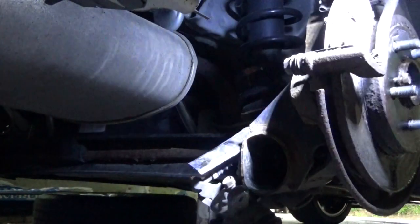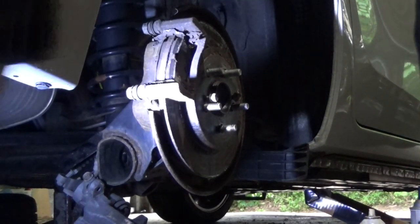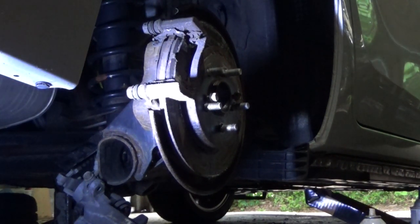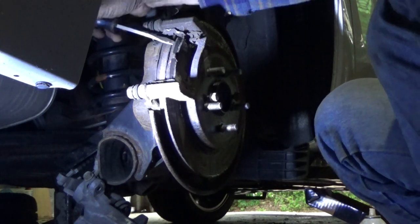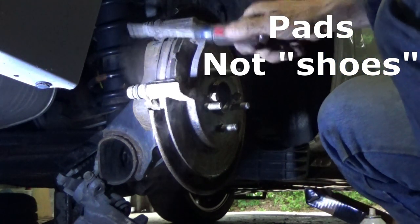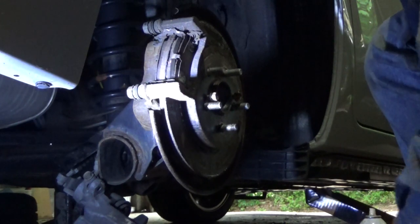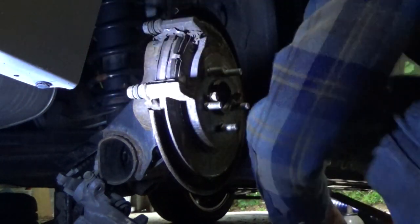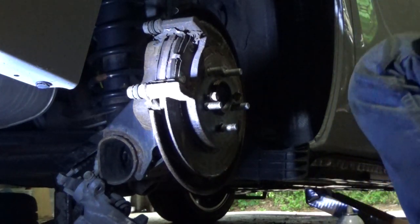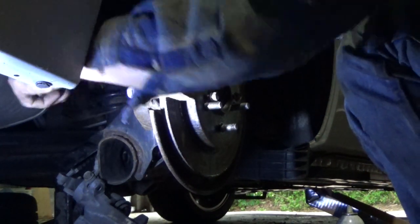Now get this stuff here apart. Get you back here where you can see again. Lit up well enough? Yep, good. All right. Now, we get some strange clips in here. Now we got to get these brake shoes. Coming apart in layers. Caliper bracket bolts. Countersunk. They feel like 14s. Now let's see what we got. That's a 17. That's not going to be it. Nope. Alright, where did my 14 go? There it is. What's this, 14? Yep, it's a 14.